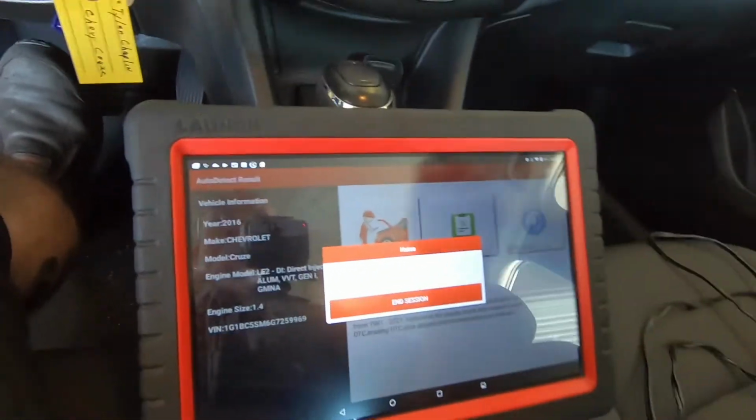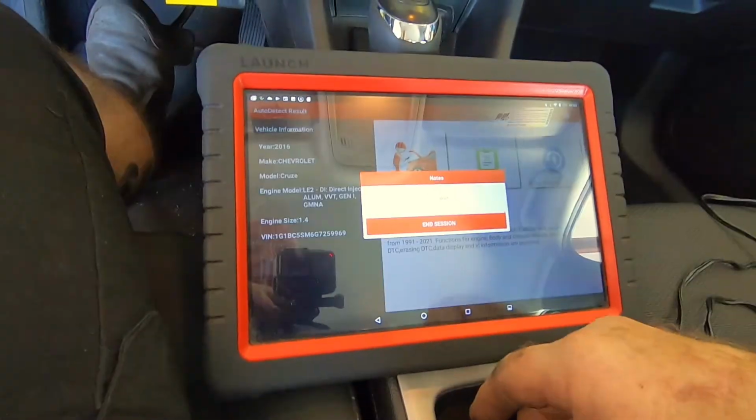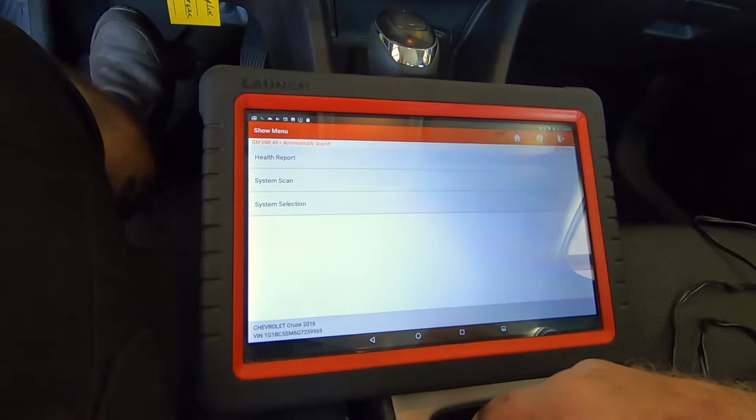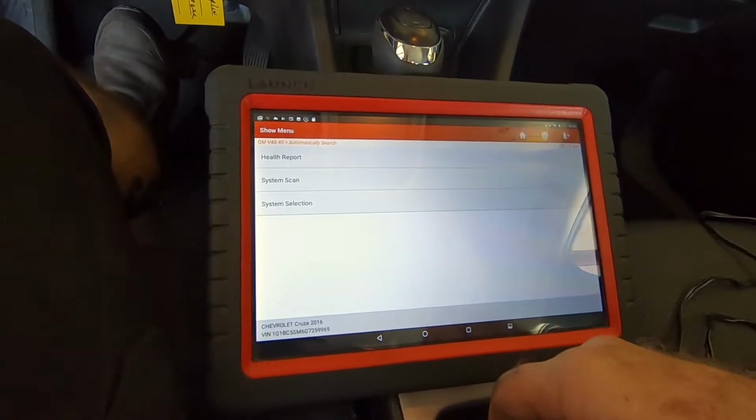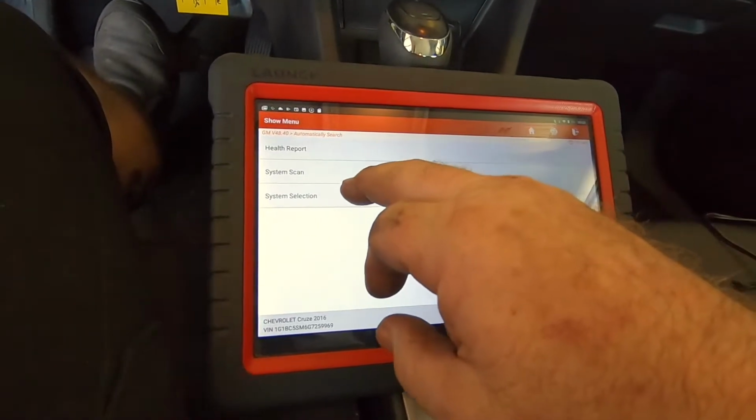Cleaning a mass airflow sensor is good to test it, but once they've been contaminated, it's a better idea to replace them. I'll clean them just to test them and see if that was causing the problem, but the contamination actually causes them to overheat and ruins the filament wire in them.